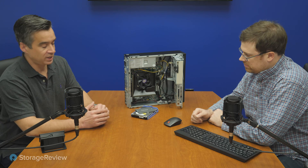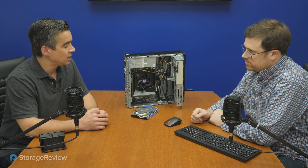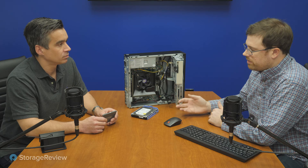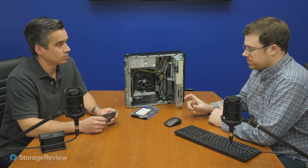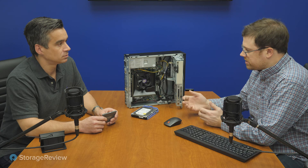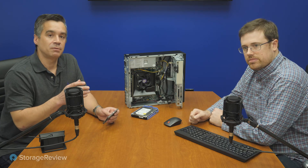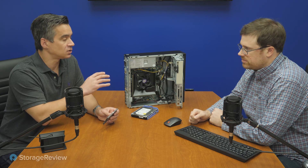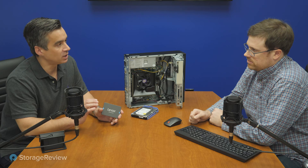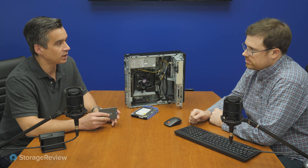So it's a super easy upgrade for under $150, and now we're all-flash on our small form factor system. It's really easy to install. A lot of modern platforms, you don't have to deal with Windows COA stickers. You swap the drive, download a generic Windows 10 ISO, bring it to a thumb drive using the Microsoft utility, and the first time the system turns on it accesses the license and just licenses itself. The Windows license is embedded on the machine, so even when we swap drives, it picks up the license and carries on — that's really the linchpin that seals the deal.